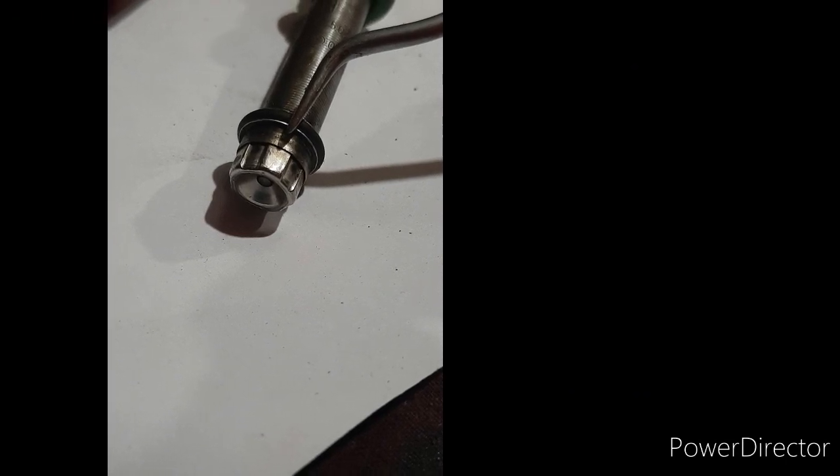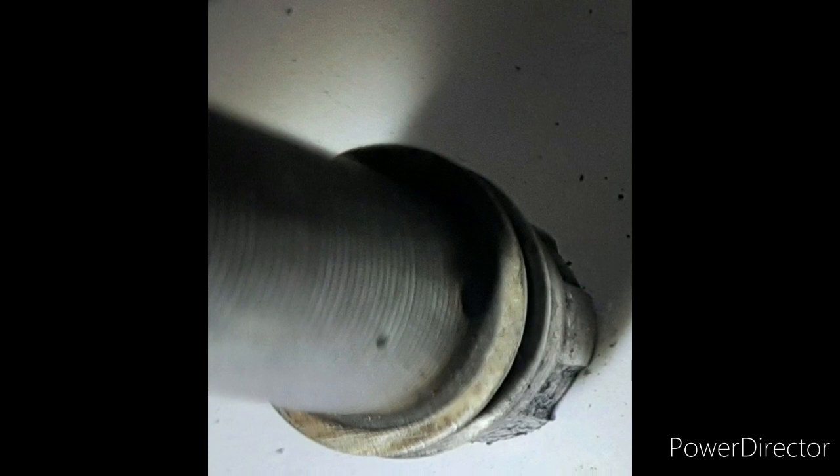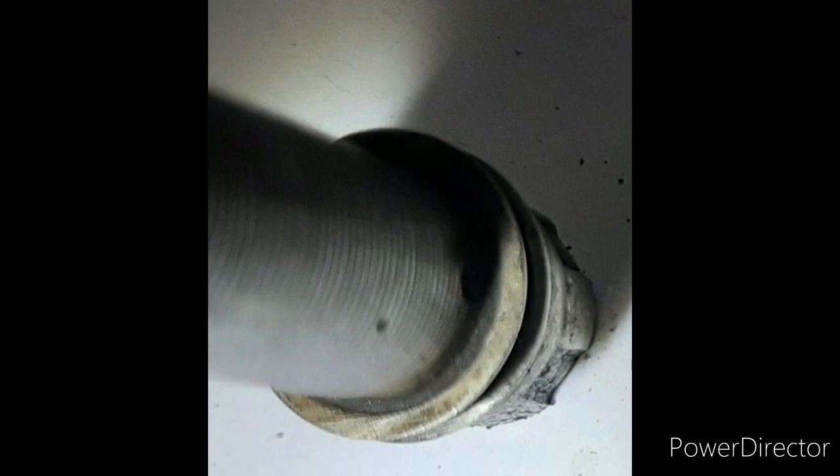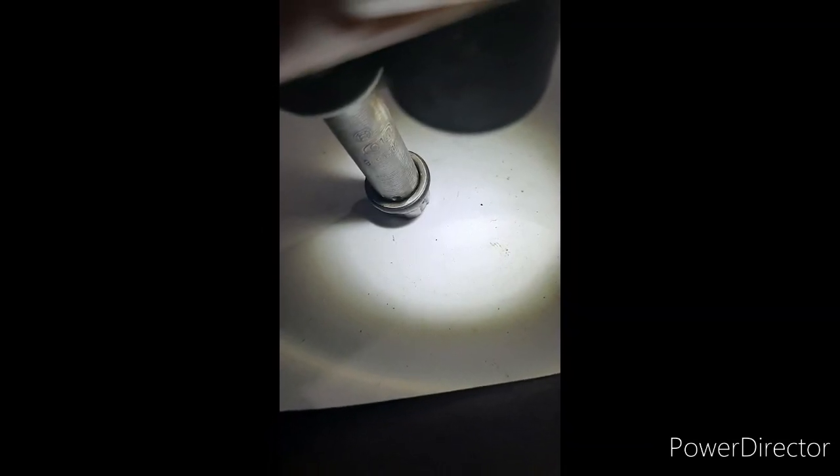As you can see here, the air is coming in where I'm indicating on the higher raised section of the top hat of the injector. From there it shifts sideways a touch and comes out of the lower sections, surrounding the fuel being discharged from the injector, giving it the shroud of air. This is one of my top hats — you can see the ridge between the top hat and the injector body is full of crud. This all comes from the air filter over 30-odd years, and that is what came out of it — about a 5p piece in size. And now it's nice and clean, all ready and breathing through.